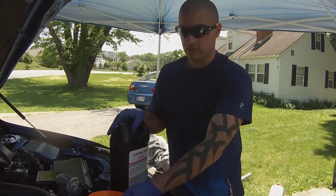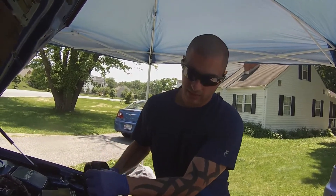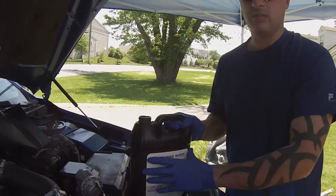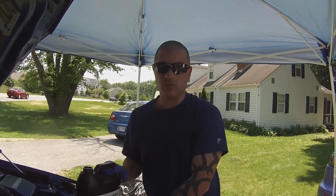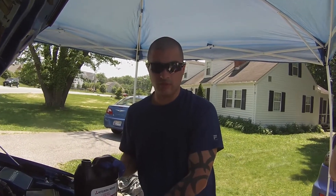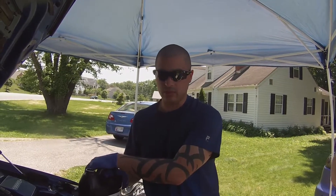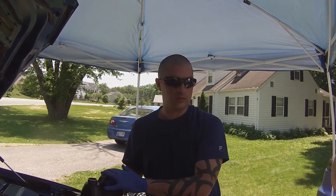If you have any questions you can reach me directly at the store: 443-707-5951. The last thing I'll leave you with: we're using Mitsubishi Long Life Super Coolant, but you can use Pentafrost, Amsoil Royal, or Mishimoto — they make a great coolant. Any high-performance coolant will do. You don't want to use generic 50/50 coolant from AutoZone — you want to use a performance coolant, because this car runs extremely hot and is a performance turbocharged vehicle. You want a coolant that doesn't break down from the heat and can do its job.